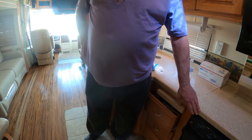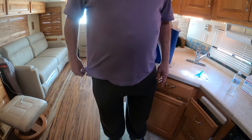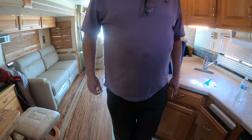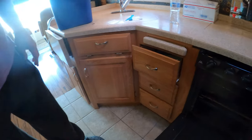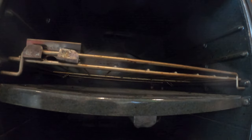We figured out how to light the top of the stove. How would you light the oven? There's a pilot — you have to light it with some kind of a match. It's way in there. Look really carefully. Let it burn for about 15-20 seconds before you fire up the stove, because there's a little thermocouple in there — it's a safety device. If that thermocouple doesn't get hot, it shuts the gas off.